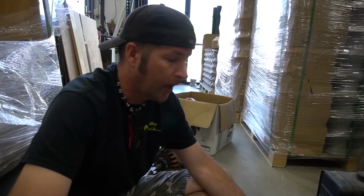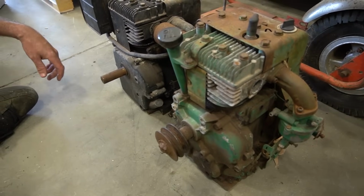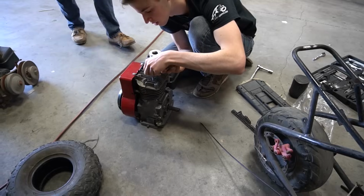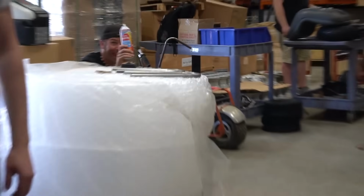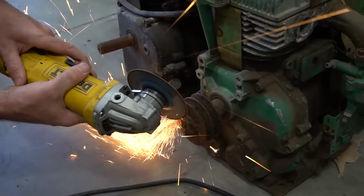That's fine. I'm thinking tying the two engines together with the chain sprocket and having the clutch on the back, and running to the rear wheel. That sounds good. If y'all have anything to say, it works fine. You need some starting fluid? Let's go straight into starter fluid after we check the spark, because that'll eliminate any carb issues.